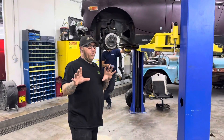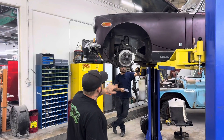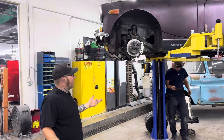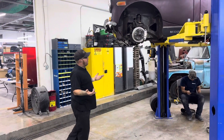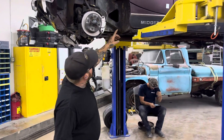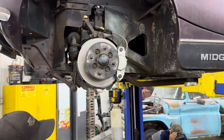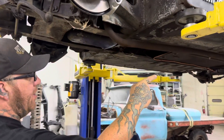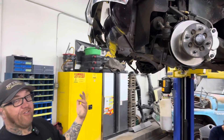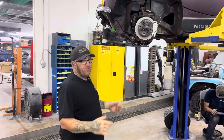We get a lot of cool little stuff — I mean, this thing is small, look at that. It's like a matchbox car — my hand is literally as big as the brakes on this little thing. This is under one of those inspections. He'd like to do some kind of partial or full resto on it and wants to know what we're getting into. A couple things we've found already: they're literally using a copper line for a brake line, we've got brake hoses that are not secured completely, there are some dents on the bottom with some minor rust coming through. It's actually a pretty decent car from what we can tell so far. Getting under it and looking lets us give you feedback on what we're trying to do — the inspection is the best way to do that.